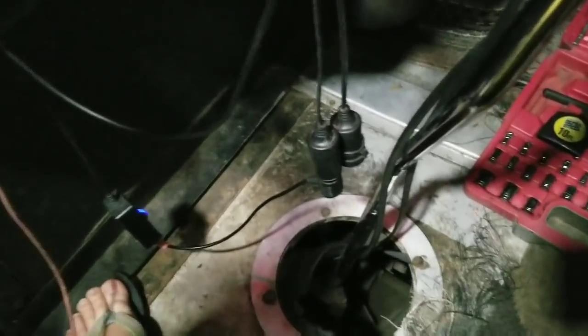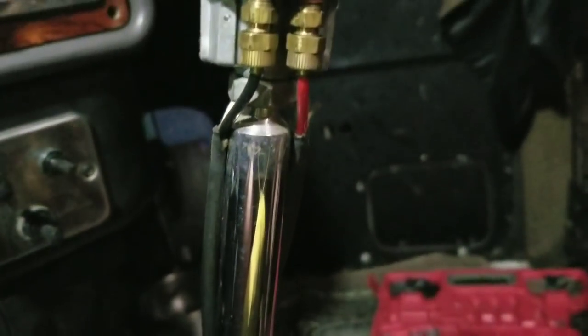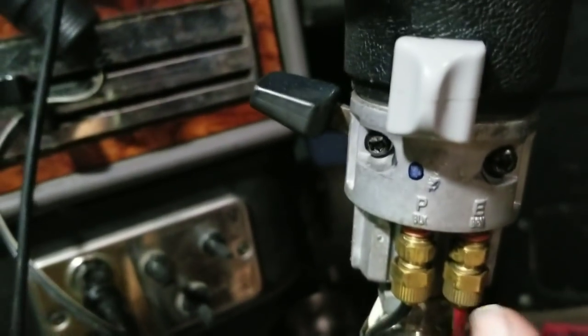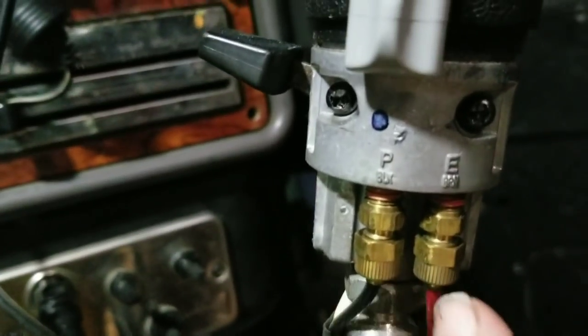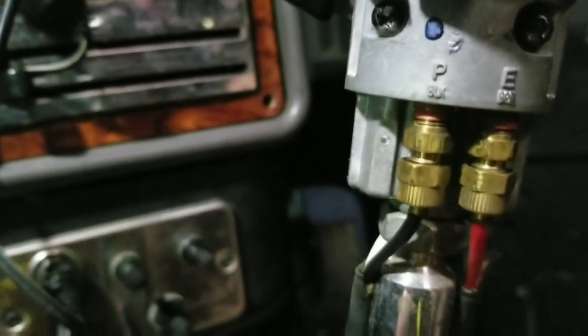Okay, I have pumped down the air. Got to get the air out of the system as much as possible. I have loosened the front and the back of the cover. I'll slide that down out of the way. And I would advise you to take a picture of these airlines. They're 4 different colors, and you don't want to forget how they go. So when you go to hook them back up, you want to get it right.